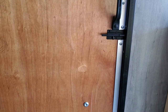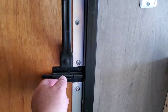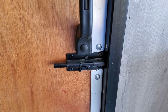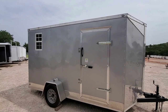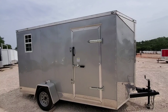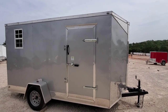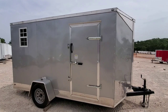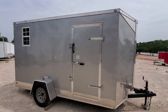Last but not least, the interior door latch is a simple barrel bolt. All you do is pull the door closed, slide the bolt over, and it latches the door from the inside so it can't be opened from the outside — you're safe and secure inside. The walls and ceiling are insulated with one inch polyisocyanurate foam board insulation, giving an R6 value. It helps keep the trailer comfortable even on a warm day without the air conditioner running, and of course with the air conditioner running it keeps it really nice.